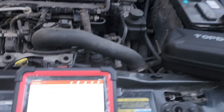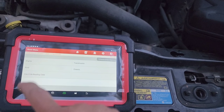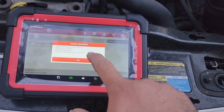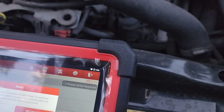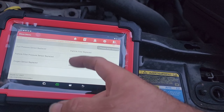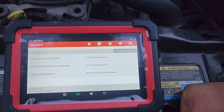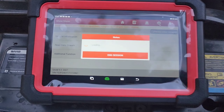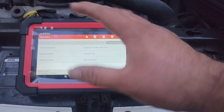I keep having to turn that back on — I wish it would provide power all the time. Reconnecting. The engine ECM — let's go. Vehicle actuation, special function, idle, EGR... no. I reconnect and go back. There's no function. I don't think so — unless it's because I'm not subscribed; I don't have the full subscription. But I do need to be able to marry this ECM to the vehicle. It does scan, and I am able to do certain things with it.